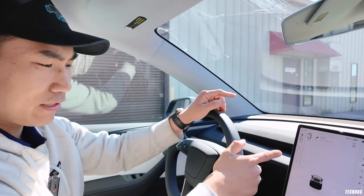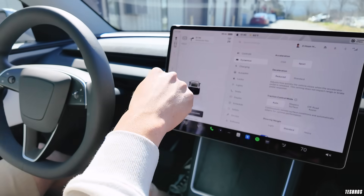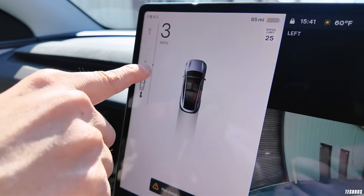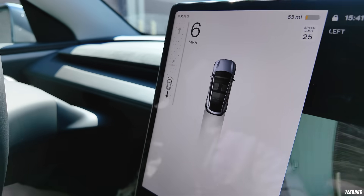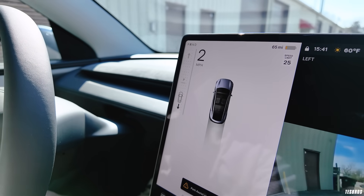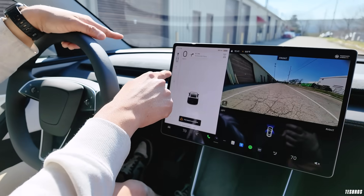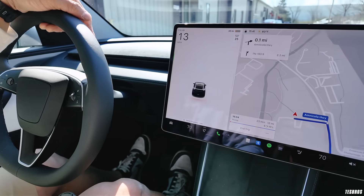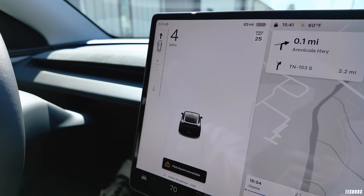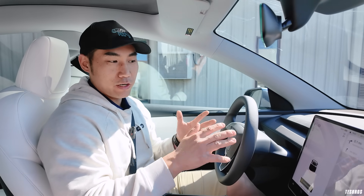Let me show you this — I'm going to use the brake in Reduced mode. When I press the accelerator, the display goes black, meaning I'm consuming energy. When I let go, it turns green, which means I'm getting regen and power back to the battery pack. When I use the brake going about 10 miles per hour, it blends the regen into it, so I get power back. Historically, when you use the brake with regen off, you get no regen — just mechanical braking.